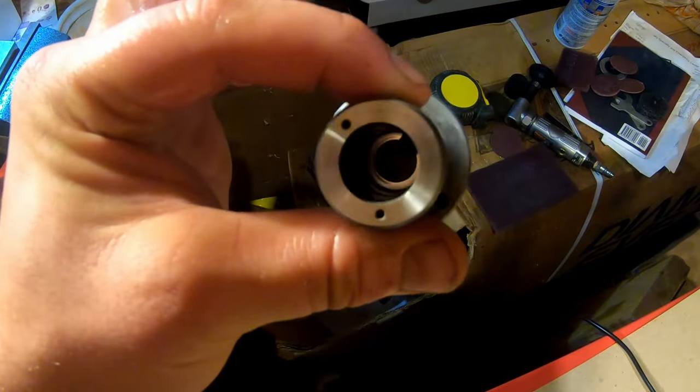Okay, so the last thing is the sealing washer. And what I do, because that other video said it, I like the idea, put a little sticky grease because you don't want this thing falling off your nozzle when you're inserting it. And I'm keeping, there's a little ridge here. See how this is like a little trough? I'm gonna keep that ridge up on all the injectors.